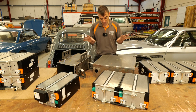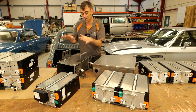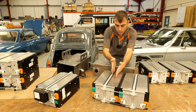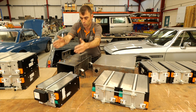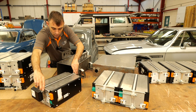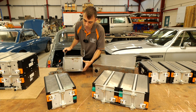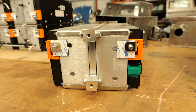So now you can see what we've done. We've taken that top layer off, split it into two pairs: one pair will go in this box, another pair in a very similar box, and the remaining four will go in the front box. These are one module, another module, and in between is the sandwich plate, which is the coolant plate. Then there's another pair bolted together. If you imagine that sliding in there — and if I spin it around, you'll see there are mounting points at the end, on top, and underneath. That's essentially how we mount them and hold them in place.